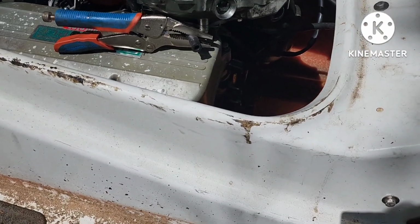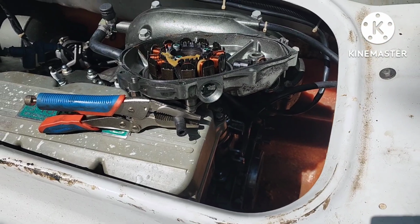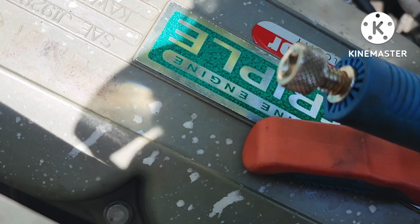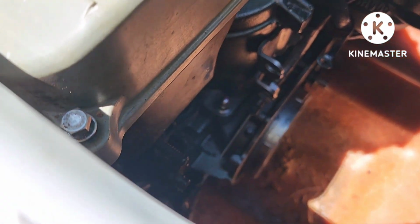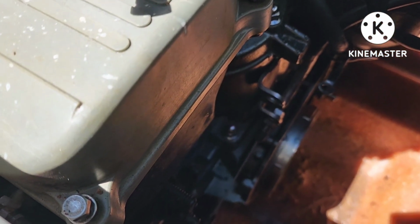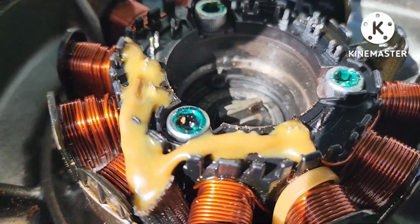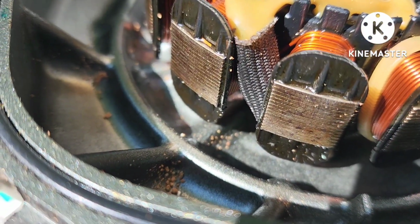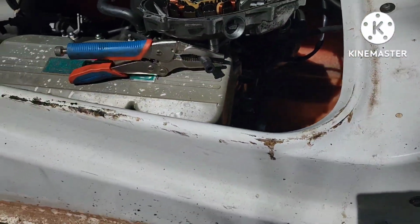That'll help you out. I'm gonna go ahead and spray some brake cleaner on this. It looks like it's kind of oil soaked. Which, if there is oil, then that means that the front seal could be leaking off of the engine. But you can see they did the oil mod, but they did not remove the secondary shaft when they removed the oil pump. You can see the bearings.